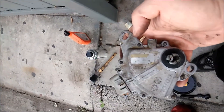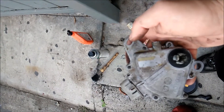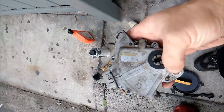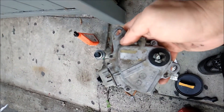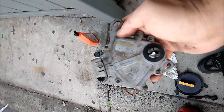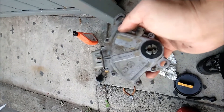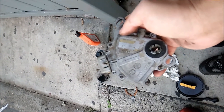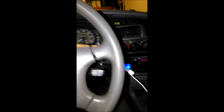When putting it on, note this oval slot here — one bolt goes there and another one there. This is adjustable, similar to timing on a distributor. You have to get the center position right so the car should start in park and in neutral and not in any other gear. Let's see how it goes.